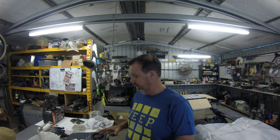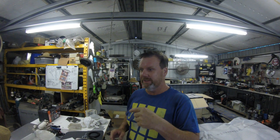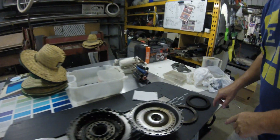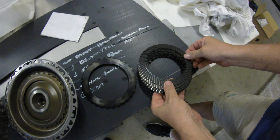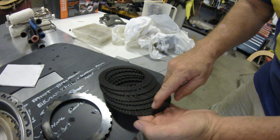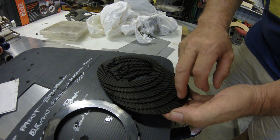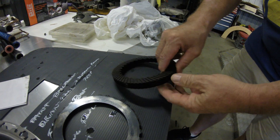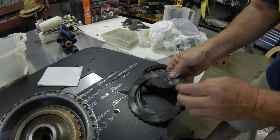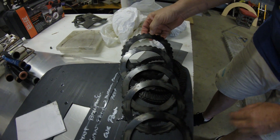As you just saw, we've taken the gearbox out and we've got the mechatronic and stuff here. I came back home with a clutch and I pulled the clutch apart — a bit excited, forgot to film it — but found the problem and there it is. So this is the K2 clutch. As you can see the fibers — it might be hard to see but I've measured them — pretty much the same as a motorbike clutch, the ones closest to the basket wore faster. And this is the result: they've worn, they're not gripping anymore, and the clutch plates are burnt. This clutch is cooked.